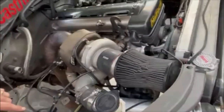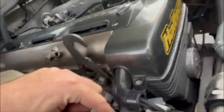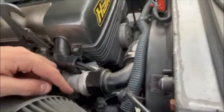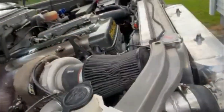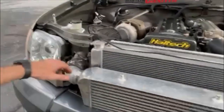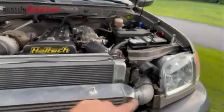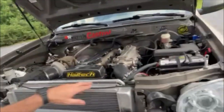I ended up doing some AN fittings as well. Had a lot of issues with those leaking. So we did the dash-20 weld-on fitting here and shaved the little coolant ports that go to the upper neck. And also down here there's like a 45-degree angle on the bottom. I went with this triple-pass radiator. It's a side-flow and you can actually see the little divots in there that are welded, so the water has to pass through the radiator three times before it goes in or out.